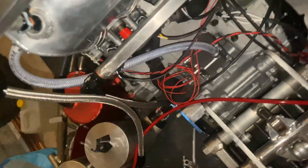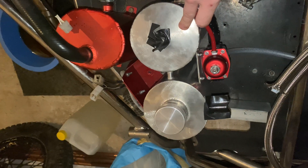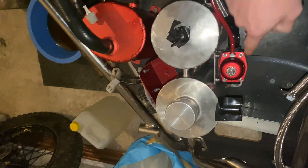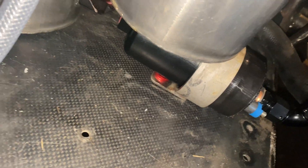Now that we've got all the parts back from fabrication for the fuel system, I can show you how this all works together. We have our main fuel cell here. This tank has a slightly higher bottom than that one, so any fuel slosh pushes it out into the outside tank, which is where the inlet to the fuel pump is going to sit — you can see that just down there.